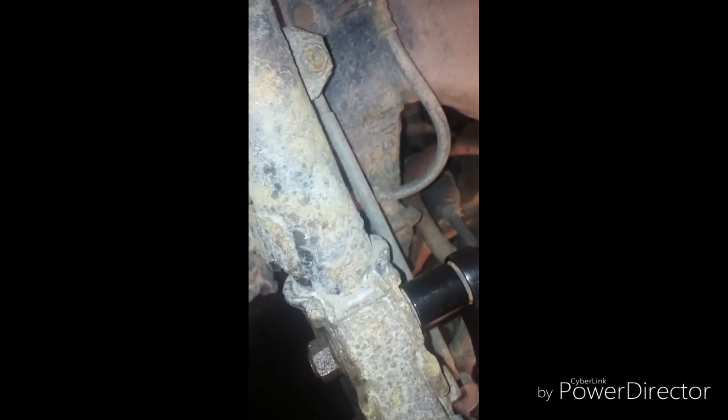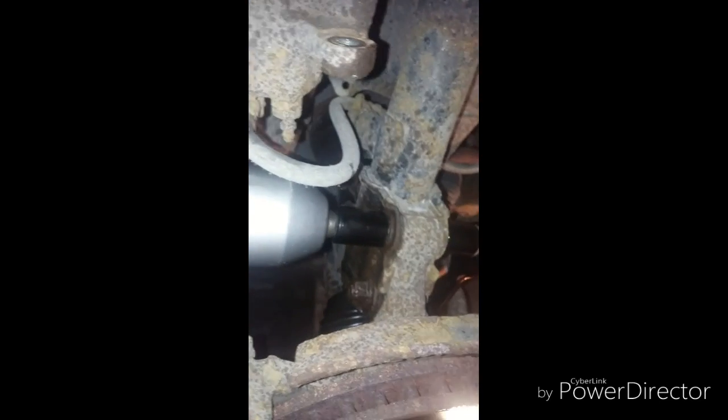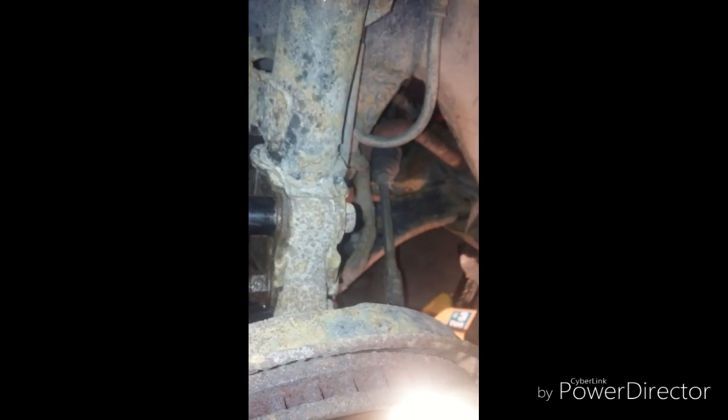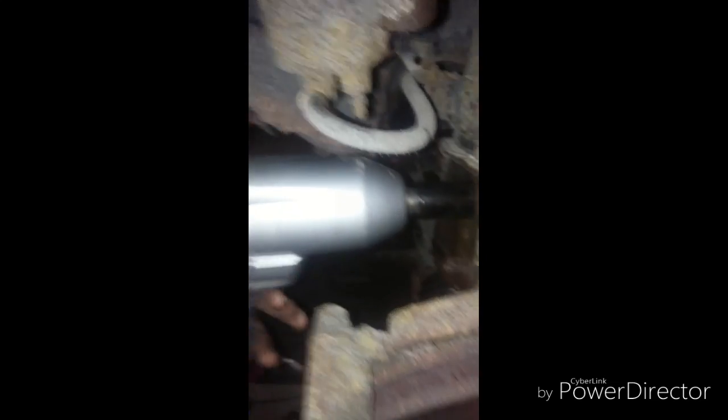If you're doing your brakes, this is probably a good time to do it. For this you need a 19mm. I'm going to put a 19mm socket on this side just in case it starts spinning. As you can see, it is spinning already — just hook up the handle somewhere to secure it.